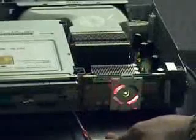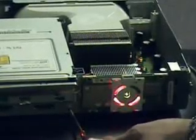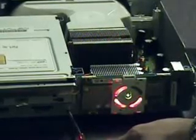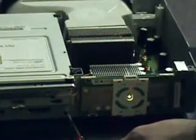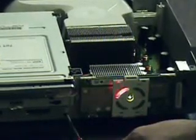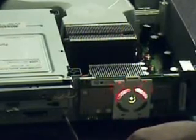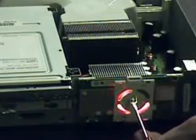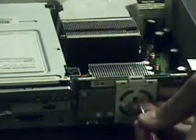I'm going to push the sync button and hold it down. I'm going to push eject three times without letting go of sync. One, it's a zero. One, zero again. And then two, and it's going to go black to three. What we have here is a secondary error code of 0102.